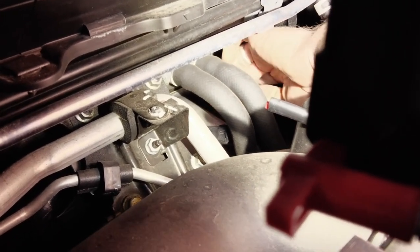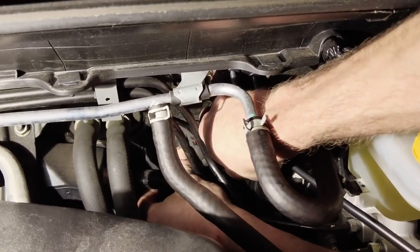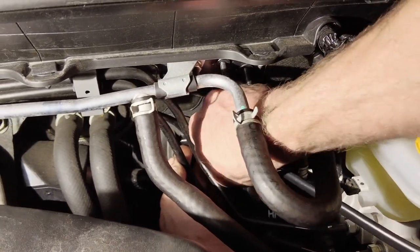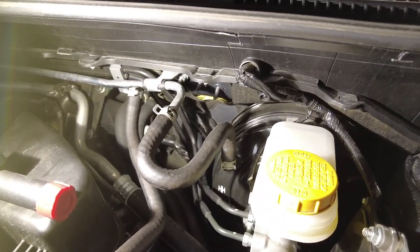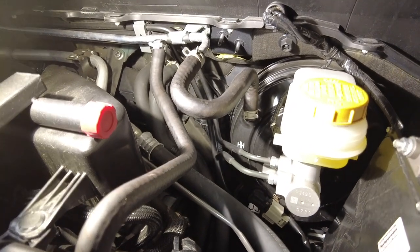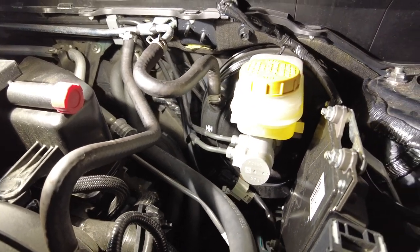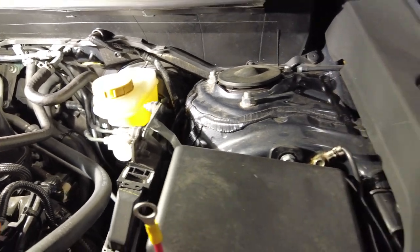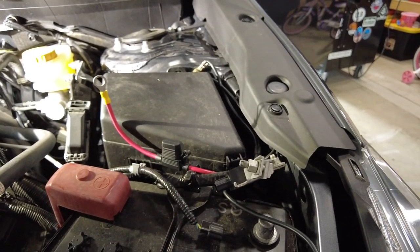Just make a really small hole and then use your fingers to break it a little bit open. Coming out of this rubber grommet, we went behind and under - kind of to the passenger side and under the brake booster, then up around the booster, behind the computer, behind this fuse box, and straight into the battery is where we're going to terminate it.